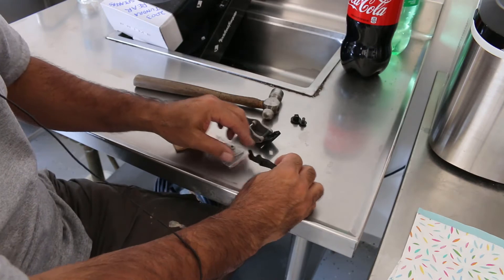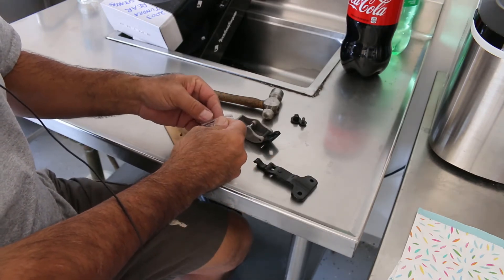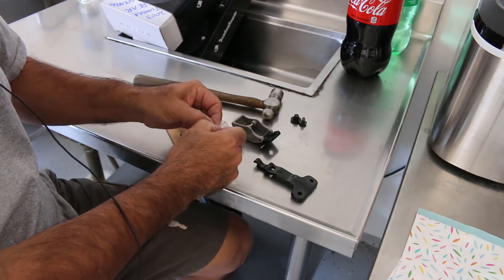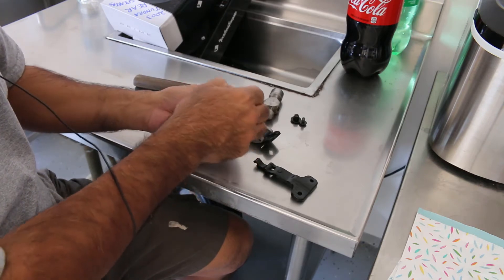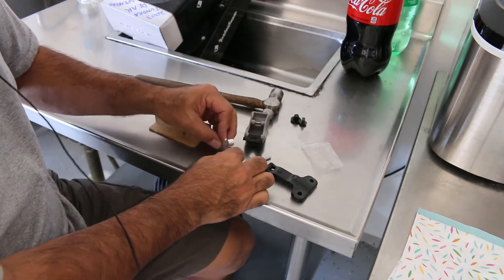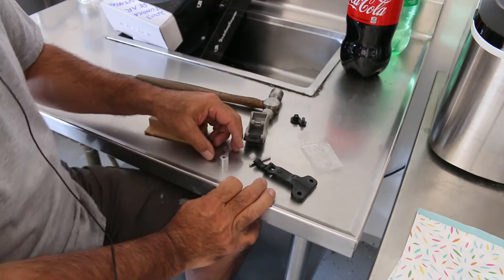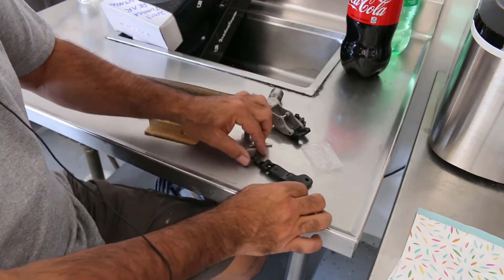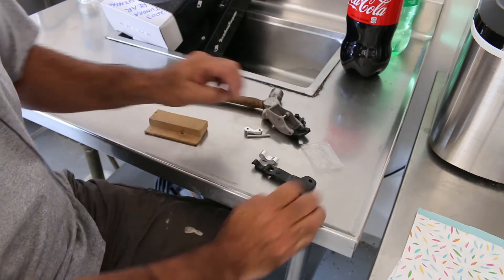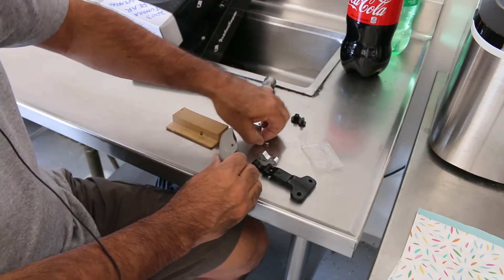Here are our parts. I've got a piece of wood with some holes drilled in it and a ball peen hammer. First off, you'll notice that everything is oriented a certain way. The two links are completely 100% identical — they can be used on the left side or the right side. You'll notice how this bracket is flat; this is how it goes, just like that. First thing we're going to do is drive out this pin.